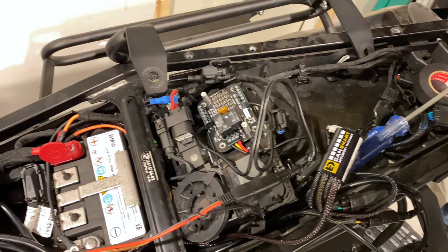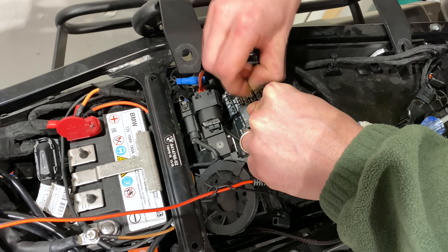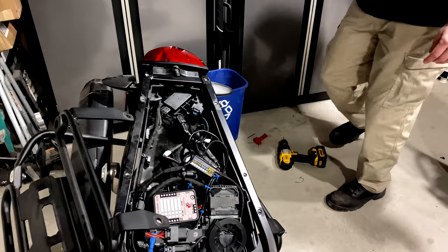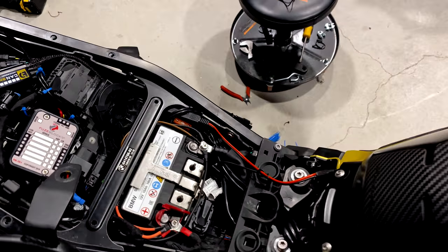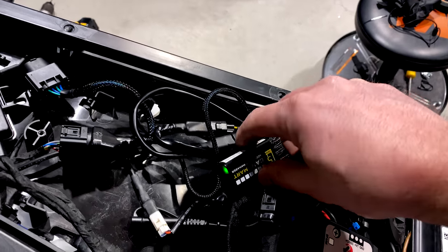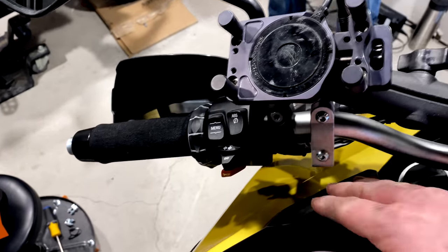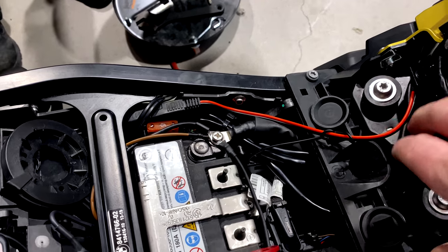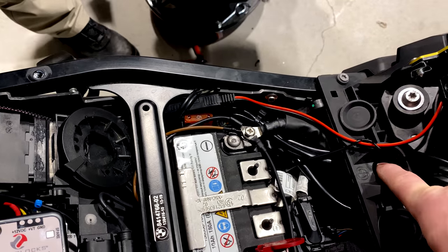The way we broke it down: 3 amps goes to the Qi charger, and 5 amps each goes to the rest of the devices — and it worked out pretty well. Here it is all going back together. You've got 3 wires going out of the positive of the battery: one goes to the CanSmart, one goes to the Fuseblock, and one goes to the external SAE I use to charge the battery. There's our SAE port right there. We use SAE because you can cap it at 5 amps and run anything off it you want.